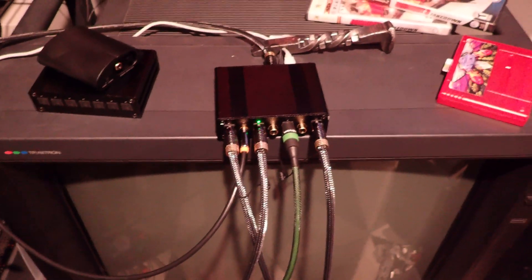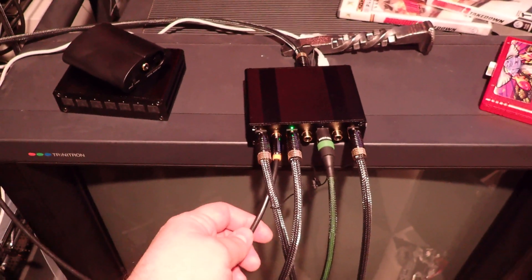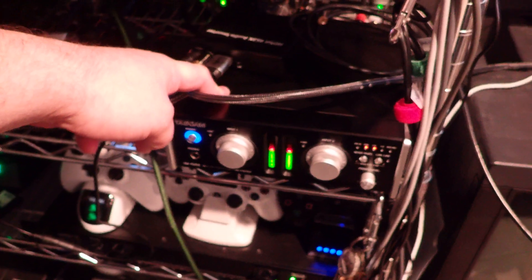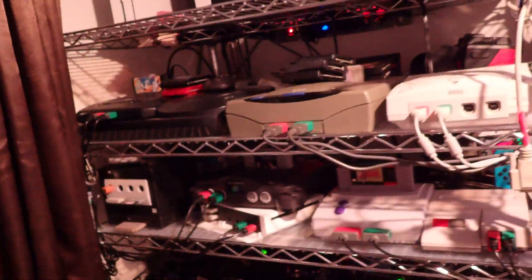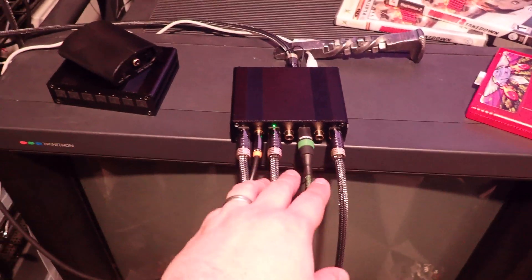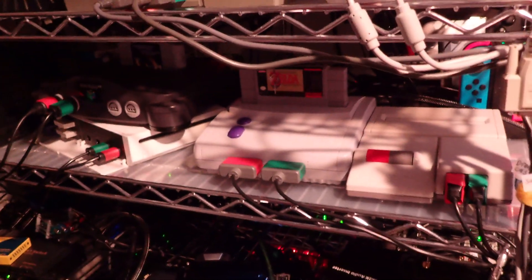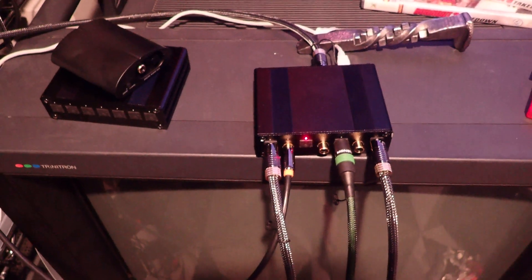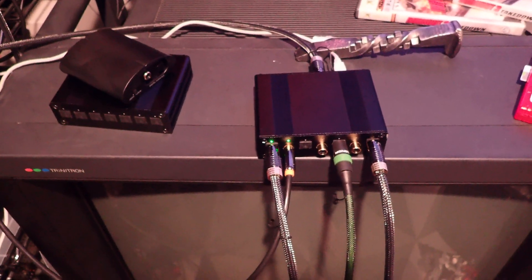The reason I've been dialing in the port priority system is because of my backup plan, which I have now hooked up to port 6 on the coaxial input of my mixed input switch. This is hooked up to an analog-to-digital converter, specifically the Tascam UH-7000, which for all my consoles that do not have digital audio — I've got lots of consoles and only three that have native digital — for any console that doesn't have it, like my SNES which has the digital audio mod, if I pull it, I get to keep my sound. That concludes my review of the digital audio automatic switches from Tindie creator Benny Skate. As long as you turn off the sound detection, they're really good.